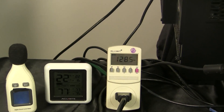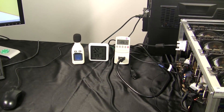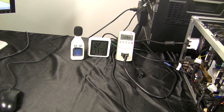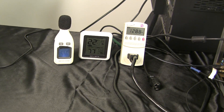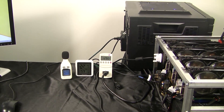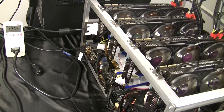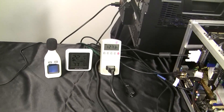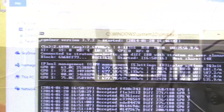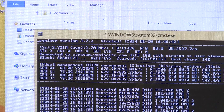The key takeaway here is that a power supply can exceed its wattage and still hold a hashing computer up — but it's not totally recommended, especially with off-brand power supplies. When building a rig, costs matter, but try not to hedge on the PSU. I've had more trouble than it's worth with off-brand units we've purchased. I usually stick to silver and gold rated power supplies and try to stay just under their rated wattage. This rig stabilized right around 1,300 watts — about 100 watts over — ran an entire night with no hiccups, though the power supply was a little warm to the touch.